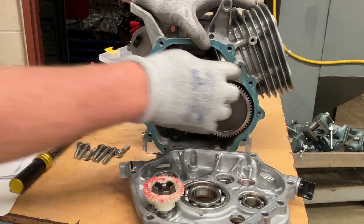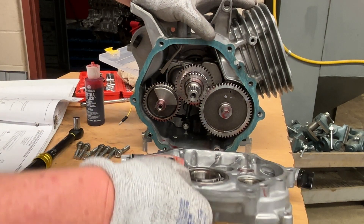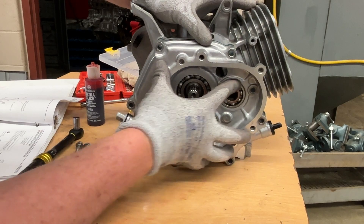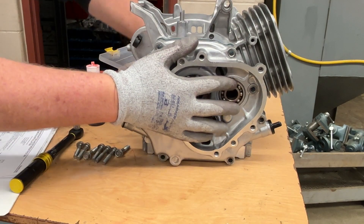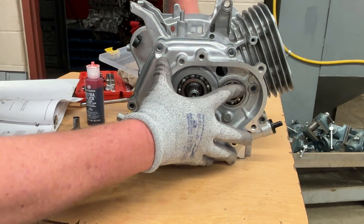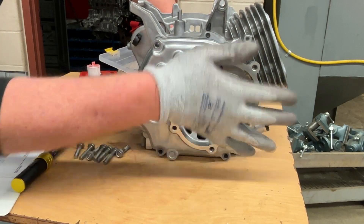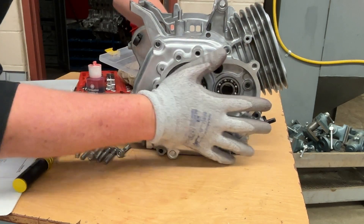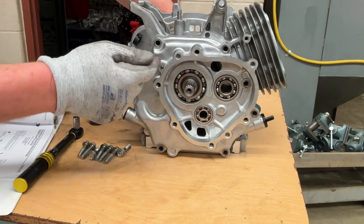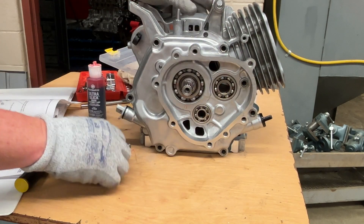My gasket has those couple holes in it that hold it in place on those dowel pins. Then I'm going to put it up and get this started. We have lots of different things that have to go into place here, so I am going to twist and turn the backside of the crankshaft while my partner is getting this cover in place, because everything has to line up and slide together. If you put this on too hard without twisting and turning, that plastic governor gear breaks. And all of a sudden it'll just kind of slide in — now it's in place.